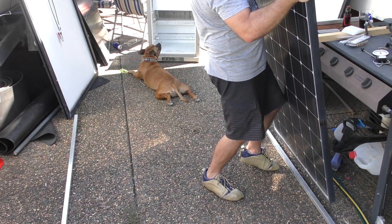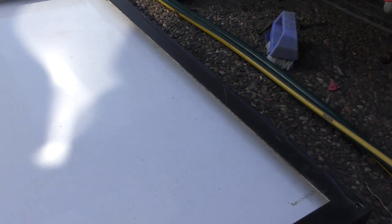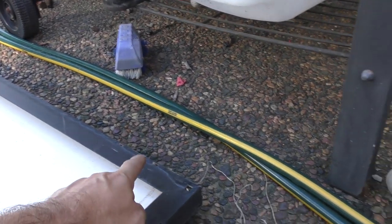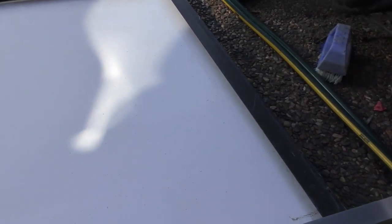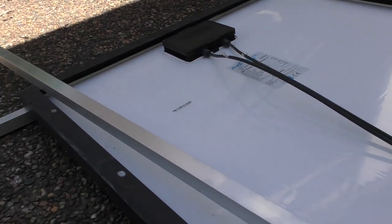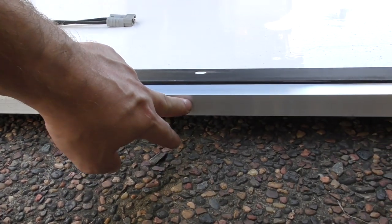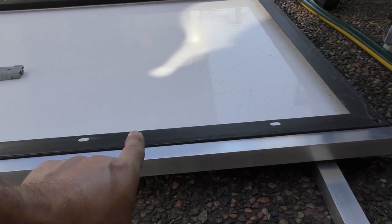As you can see, these are just that much easier to handle from a weight perspective. I've just realised another good point — if I was going to be running these beams across, I would really only have two mounting points unless I wanted to go straight across the top. What we're going to do is line things up so I'll actually be able to mount it in multiple places. I was also considering tapping through the side of the aluminium into the panel and bolting it up that way, but then all the weight of the panel is going to be supported by those bolts going through sideways.